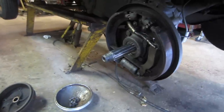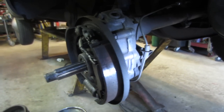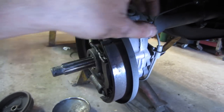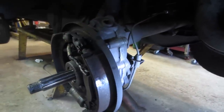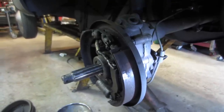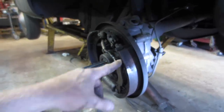All right, so I popped the wheel and the brake drum off to get a better peek inside at what's going on. And what we have back here is a gear reduction, and it has basically a shaft on the bottom and then a shaft on top, two different size gears. The gears drop down the ratio from a standard Beetle transmission, which is what early buses used, and to get around the fact that they were heavier and had to haul more weight, they just knocked the gear ratio down on the transmission. They did that out here on the ends of the axles with a set of gear reduction boxes. But I do believe we have a noisy bearing inside one of these, possibly anyway, and we're gonna go investigate a little further on,